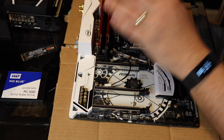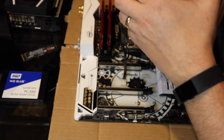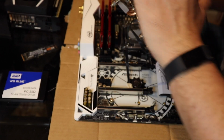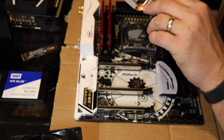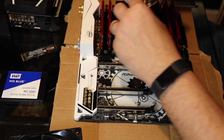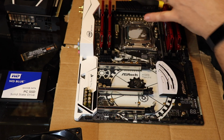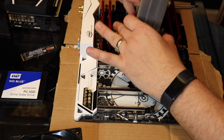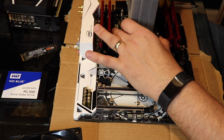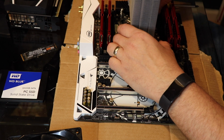Now I'm going to take this off because this fan is giving me some trouble. I'm not being too careful with my thermal paste, guys, because I'm going to do water cooling soon, and I know I'm not going to run this computer very much with the thermal paste the way it is. Usually you want this gray thermal paste to cover the whole processor so you get good contact. So I'll smear it around a little bit more. Make sure we get good contact. Looks like it's all over it now. That's about right. You want it all over it.